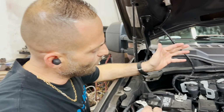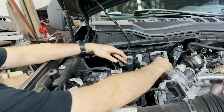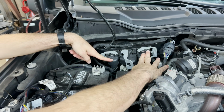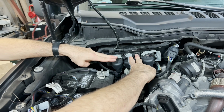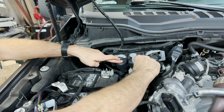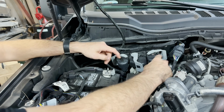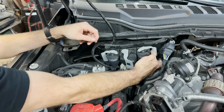All right. This is the ECU. This is the PCM on your 6.7. We have three connectors. We have the after treatment. We have the engine. And we have the body side connector that goes to the PCM. A, B, an E. Well, it was T because it used to be the trans connector, but it's after treatment now.